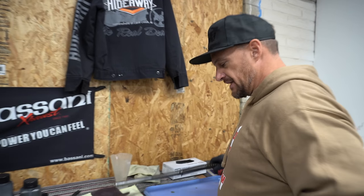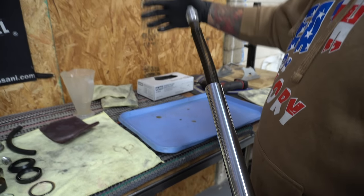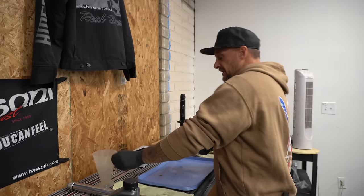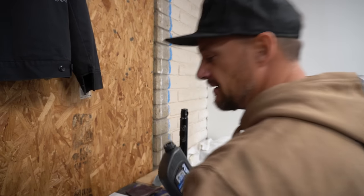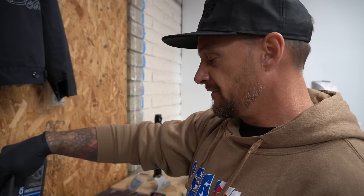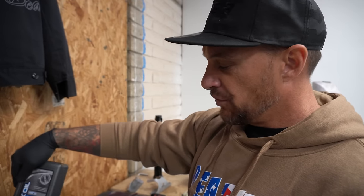All right, we're going to slide this guy back in the tube now. I've got some Bel-Ray 20 weight fork oil. We run 20 weight in these, with the stock spring. If you need a spring, I'd say a Racetech spring, no gold valve, none of that. Just put a Racetech spring in it, and it is phenomenal. We're going to put 11 ounces in. There's a measurement from the top, so you can fill it up and then fill the oil to the measurement, but I've done a lot of these, and I've measured them out and then poured them out to see how much it is, and it's 11 ounces every single time.